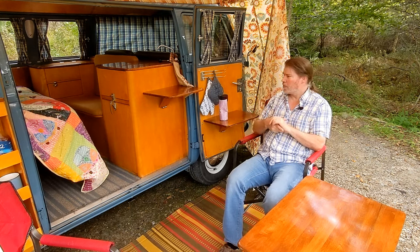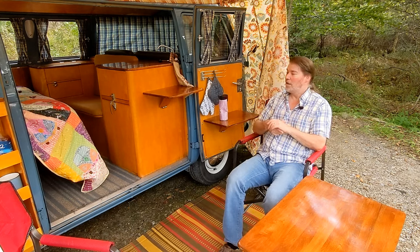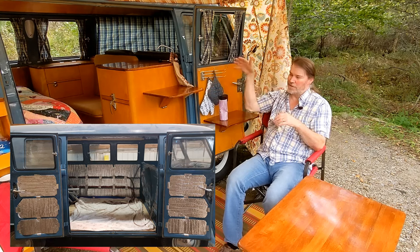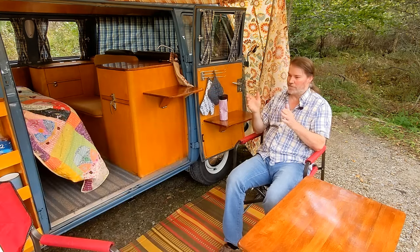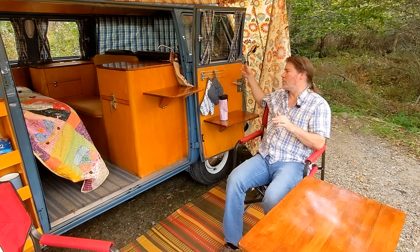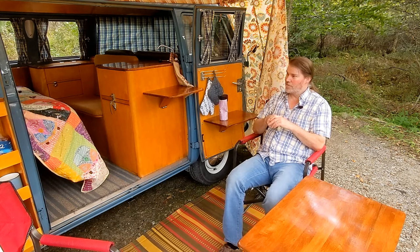And then the insulation is a double layer of bubble wrap, basically with the aluminum foil on each side. Comes in a big roll. It's fairly inexpensive, very lightweight, and waterproof. And there's three layers in all the walls and doors and ceiling. And that basically fills that gap solid. So this panel is directly against insulation, which is directly against the outside. It makes a huge difference.